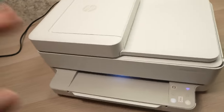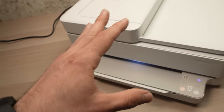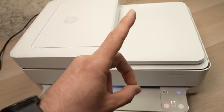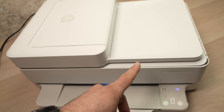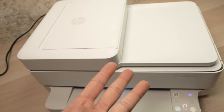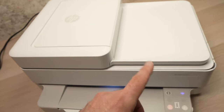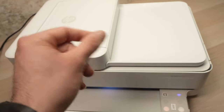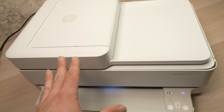This is how you clear the E0 error on your HP Envy. Make sure the cartridges are the right ones for your printer, make sure they're installed properly, and also make sure everything is clean — no spillage, no debris, no dirt. Clean it with a paper towel if you're not sure.